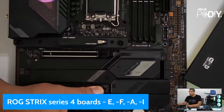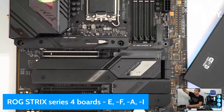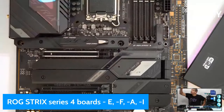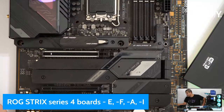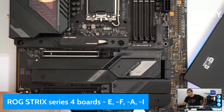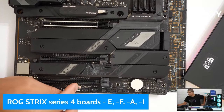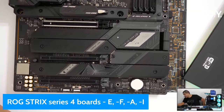Okay, large and robust PCIe Gen 5 M.2 SSD heatsink that is going to be on this board right here. So you can see it even has a large heat pipe that's going to be on there. You have the Q-release ejection mechanism that's also going to be on this board, and all of the M.2 slots have M.2 based heat sinks, so you don't have to worry about that. You do also have the Q-latch design. You'll also see right here, on the very bottom, you have the fan speed and the PCIe alteration mode switch that's going to be on there, internal USB 2 headers, the Thunderbolt header, and then, of course, your chassis fan headers. So all of that good stuff all on this board.